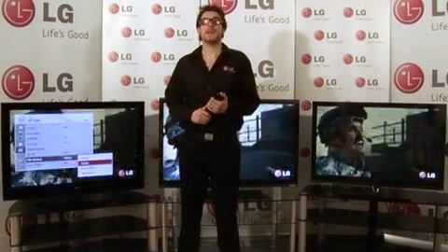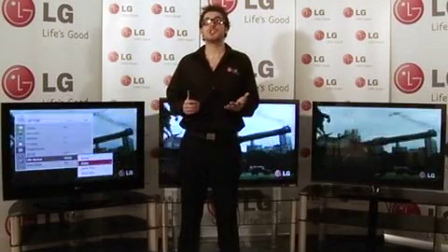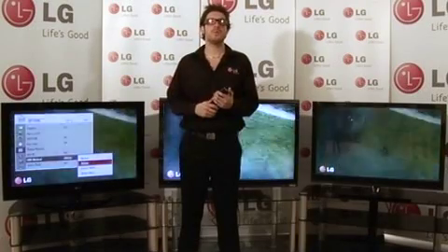There are also a few techniques that will help you prevent future image burn. For starters, changing the contrast and brightness to below 50% during the break-in period, which is the first 100 to 200 hours, and try to avoid static images. LG TVs have an energy saving button on the remote that will give a similar effect by selecting the maximum setting.